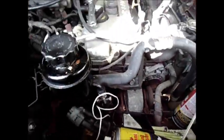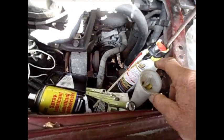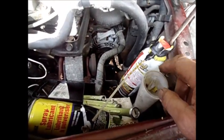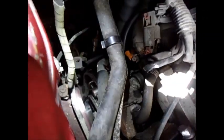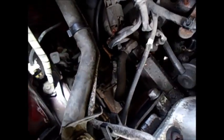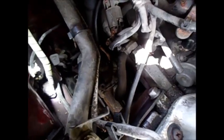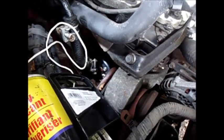We need to take this motor mount off. I took the radiator tank off. I've been using some PB Blaster to get in there and try to loosen up some of the bolts inside there — it's going to be a pretty tricky job. There's the tensioner for that belt, which is also the power steering pulley. That tensioner has to be loosened to get to that belt, but we don't loosen it until we get those bolts loose.